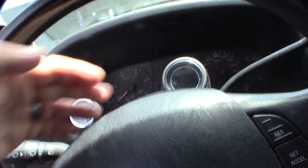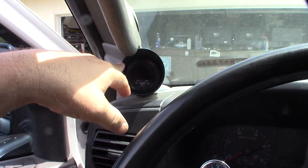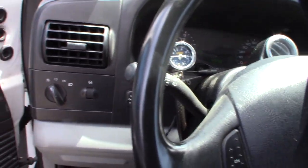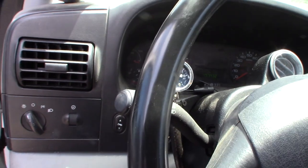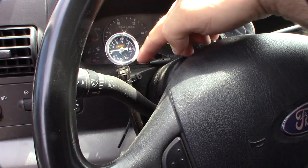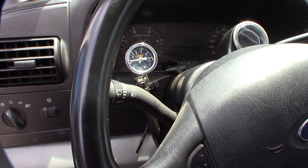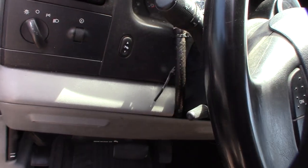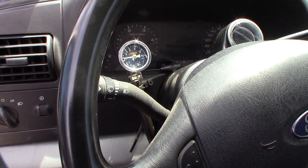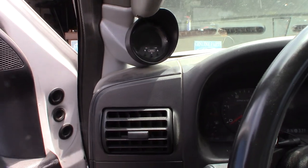Here's my fuel pressure gauge and EGT gauge — these are actually really nice EVO gauges. That's actually where I was gonna put the Bully Dog device right there. I wanted to get rid of this manual coolant gauge because it would be a nightmare if it blew off — I'd have hot coolant shooting into my cab. Plus I don't like the way it looks, so I'm actually gonna have a transducer going in as an analog input into my Bully Dog.